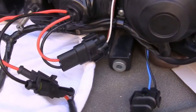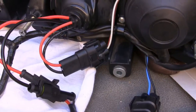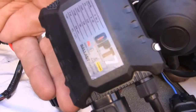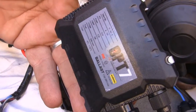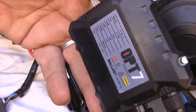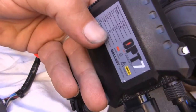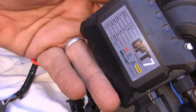There were concerns that maybe the load was too heavy, but I have a 15 amp fuse on my bike, and that's the stock, and each one of these takes 10 amps to start, which both starting at the same time is 20 amps, but I checked the amperage. It was almost instant, so I don't think it's going to get too hot. It'll instantly go to 10 amps and then just for 1 second, and then go down after that very quickly down to about 3 amps.